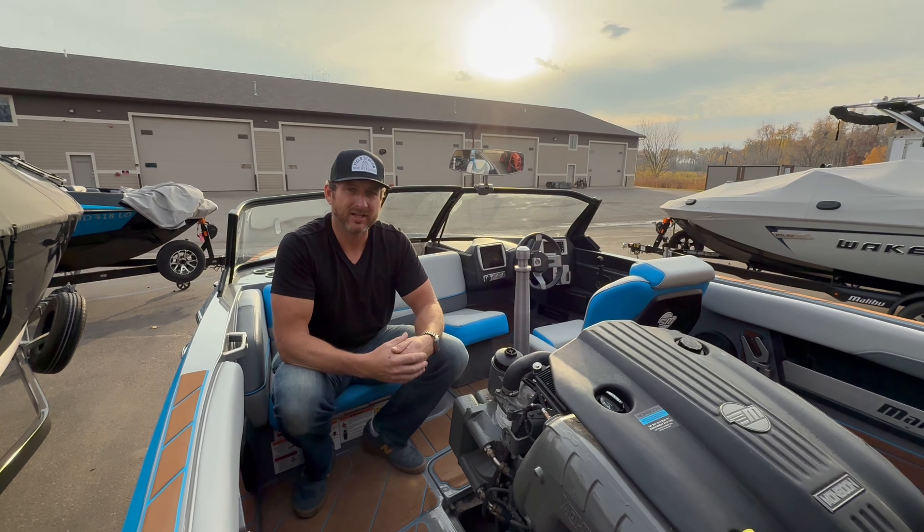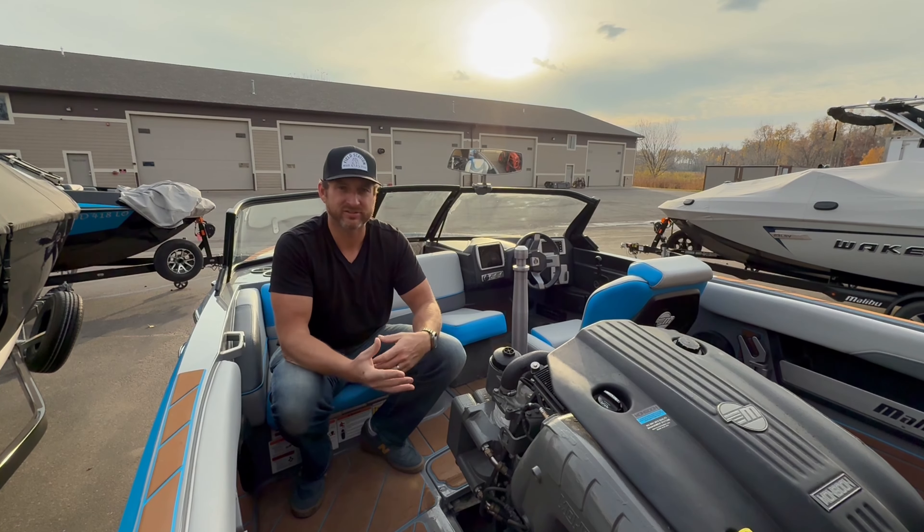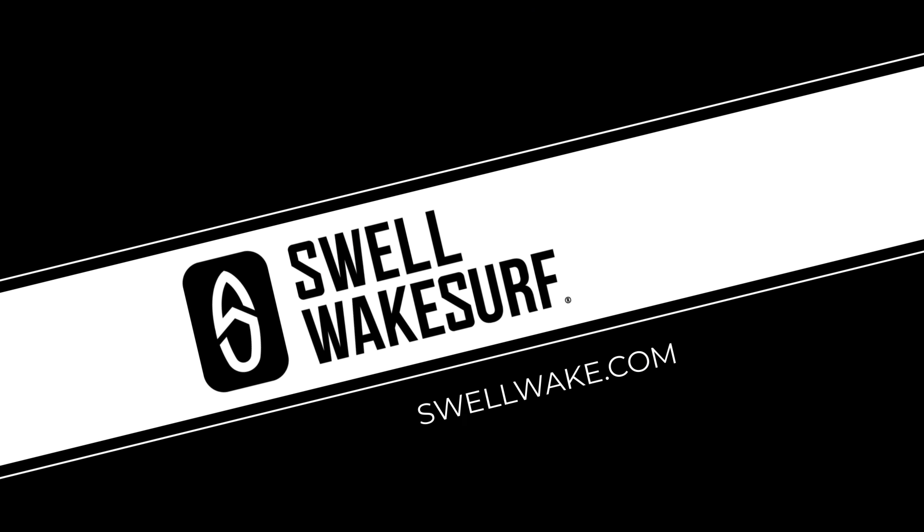This M5 motor is closed-cooled, so if you do have a heater, that's going to have coolant running through it, so there's no reason to unhook your heater or anything. That's really all you have to do to winterize these boats, and you're good to go.